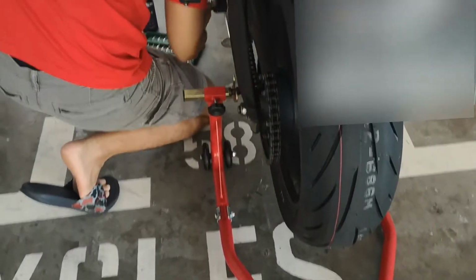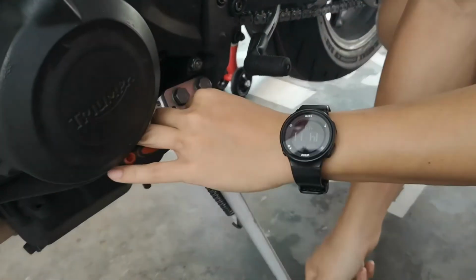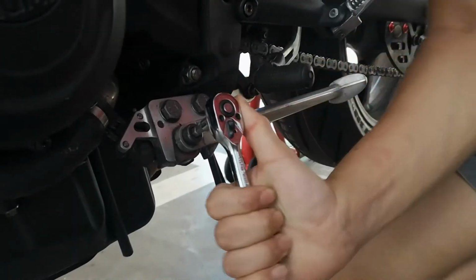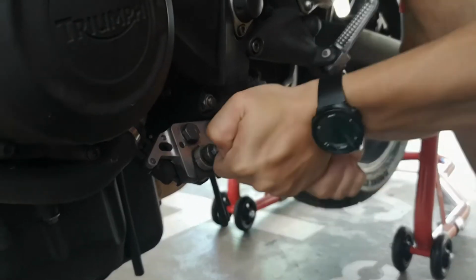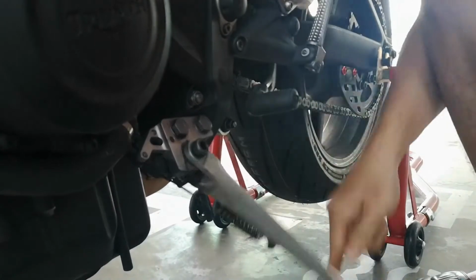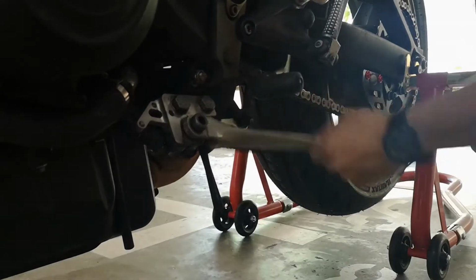In this video, we're going to show you how we repaint all the faded parts to restore it. But first thing, we found out that the side stand is a bit jammed. So the main reason is it's being over torqued. So we are trying to release the torque on the screw so that when you kick the side stand, the spring can actually hook the side stand back to the original position. You can also oil it to make the movement more fluid.